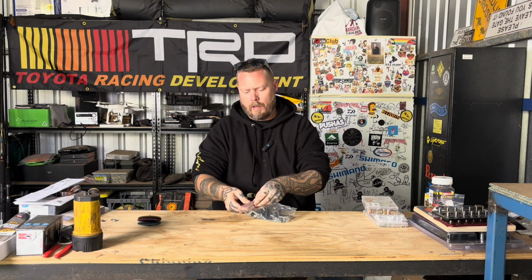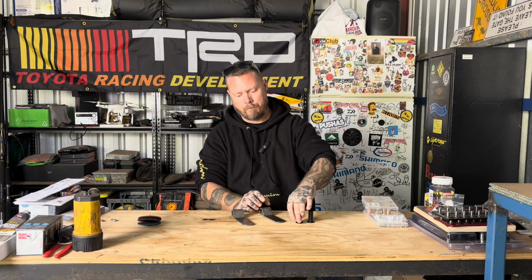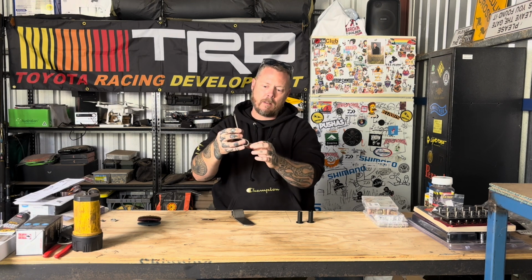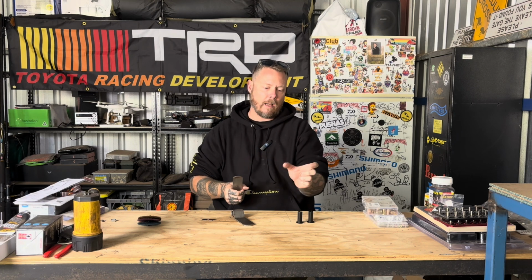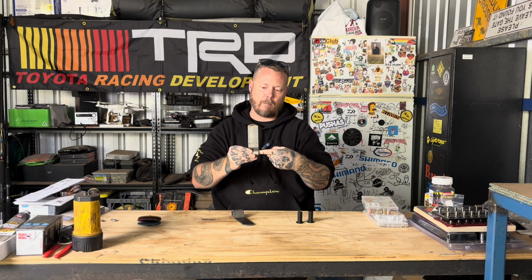I've got an 8x5 dual axle trailer, and I bought it quite cheap. But one of the reasons it was quite cheap was because it had a few little issues. Really the only issue with it was the tailgate. One of the hinges had not the pin, but the strap. This part was completely gone. It had ripped off the back of the tailgate, leaving a little hole where the steel had ripped out, and it was just the pin that this slides onto and rotates on that's left behind.